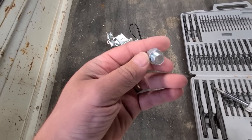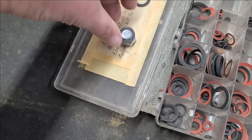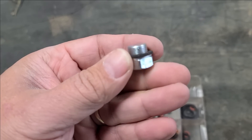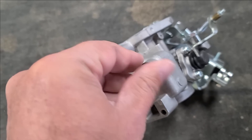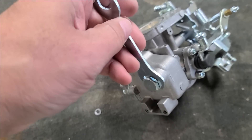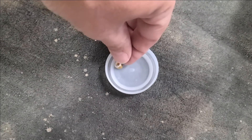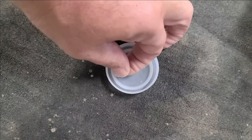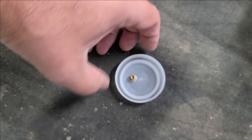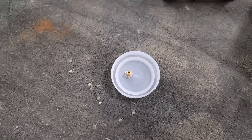They never had any kind of washer on this, which is kind of weird. I dug through my fiber washer set and found a fiber washer that fits on there pretty perfect. Brass is probably better, but I just won't over torque it. You see my pressure washer wrench fits perfectly. There's a little washer laying here — it's not from underneath the screws that hold the float down. Must be what they put behind the jet, so that makes it a little thicker. That isn't going to be interfering inside the other main jet, which was a 120.